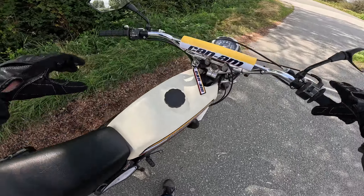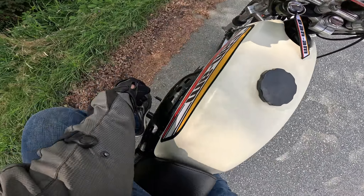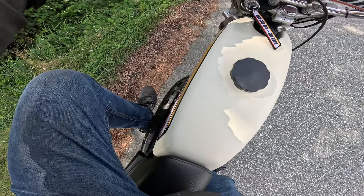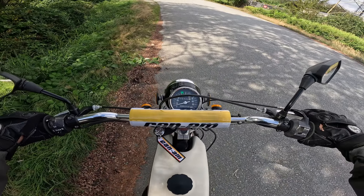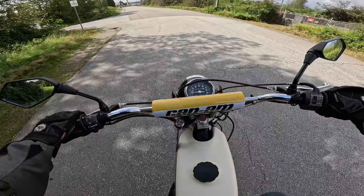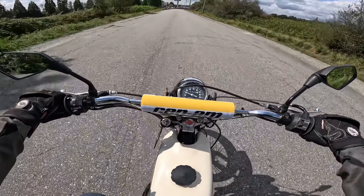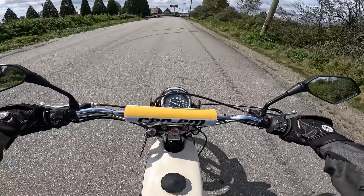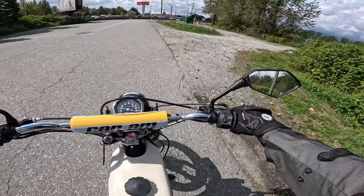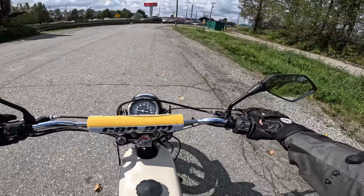Let's get off the bike and see if we can get this thing running again. I did restart it, but unlike last time where it took time to get my gloves and helmet back on, I'm going to shut it off and then try starting it now and see if she starts. I'm hopeful it just starts and away she goes. The one thing going through my mind is I wonder if I have the float height set too low and there's not enough fuel in the float bowl. Doesn't seem too likely given how I was riding earlier. I don't know — I'm very confused.